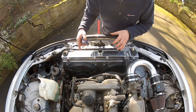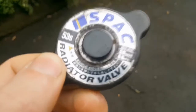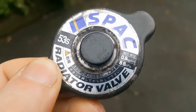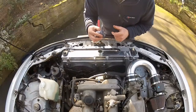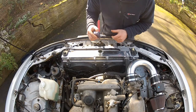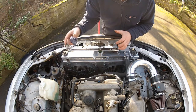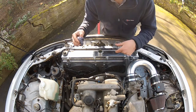The next thing I need to do is bump the radiator cap back on. This radiator actually came with quite a sporty radiator cap - it looks a lot nicer than the stock one and it also has this fancy push button so you can release the pressure from the radiator without removing the cap itself and potentially burning your face off. So I'm going to bung that on there and top the expansion tank up just a little bit. It doesn't need much and then we should be fully bled and good to go.